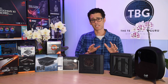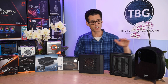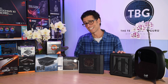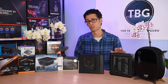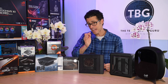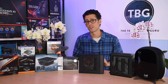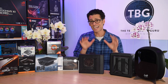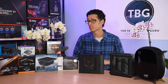To make this an apples-to-apples comparison between all three cases, I did have to use a cooler that would fit in all of them. While the Silverstone and InWin chassis allow for coolers up to 60mm, the Antec doesn't. I wanted to include the Antec because it's such a well-known case. The only cooler that fit in all three while using an AMD processor was the Noctua NHL9AM4, which stands at 37mm tall. These cases cannot use add-in video cards, and for the best integrated graphics performance you have to go with AMD.